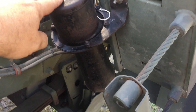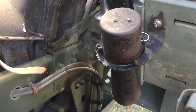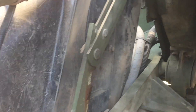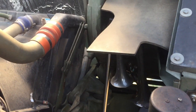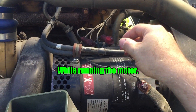The good thing is the ooga horn clears the tire and the wiring is just fine. But two major issues: I just lifted the cab and now the cab mechanism is not straight anymore — it's kind of lopsided. And I looked at the amp meter and it was only showing 24 volts, and it should be right at 28.